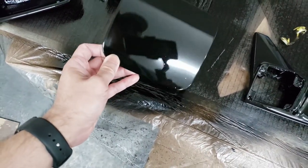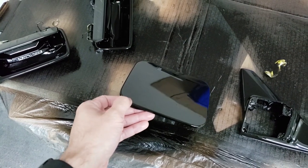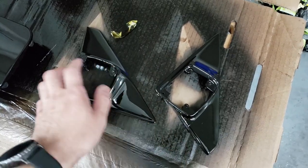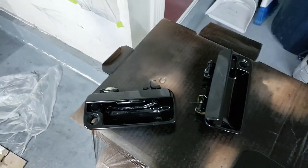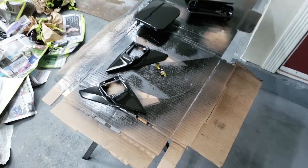This is the gas lid - looks pretty good. There are a little nibs here and there. There was also a little bit of wrinkling in some areas where the paint kind of pulled a little bit. It probably didn't dry or flash off in the five to ten minutes that it said on the tech data sheet. But overall, if you look at the whole car, it looks really good and really clean.